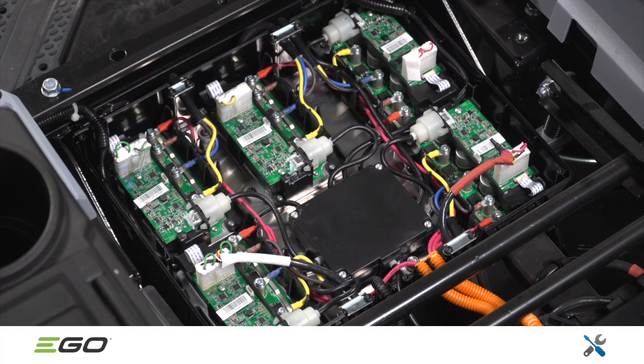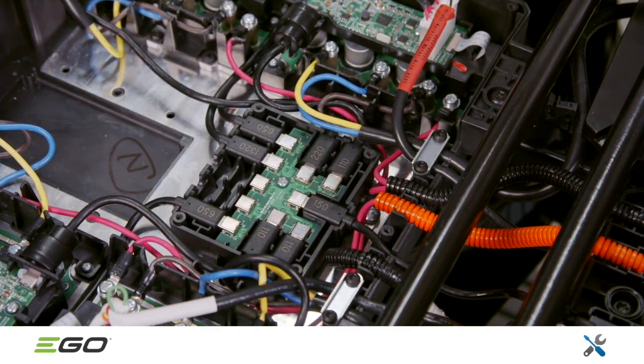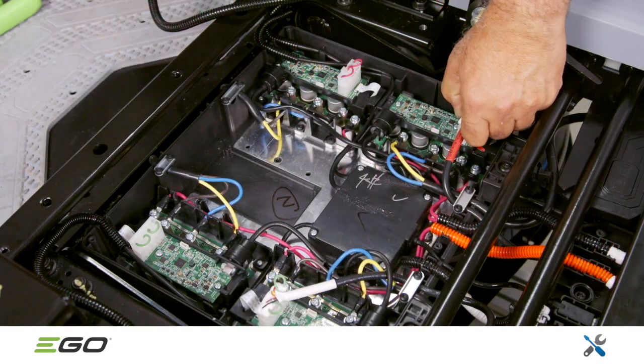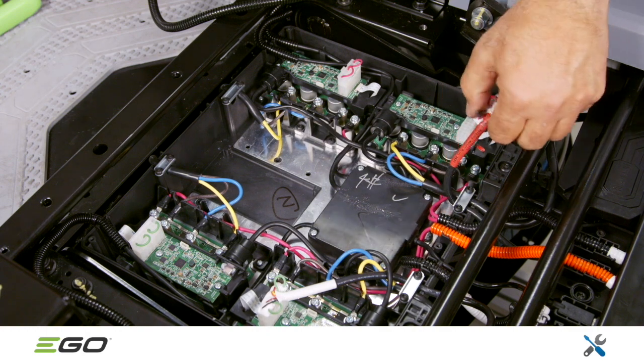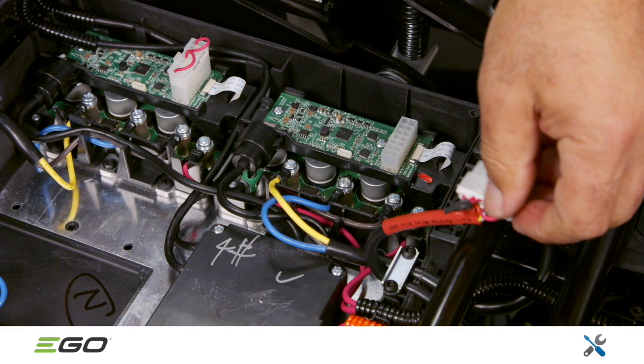They're simply wired differently. The wires from each PCBA connect to a separate compartment within the control box. This box also contains connections to the steering lever control assembly and the front frame assembly. To remove any of the PCBAs, start by releasing the 14-pin connector.